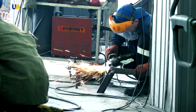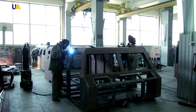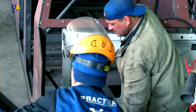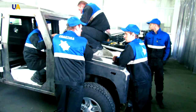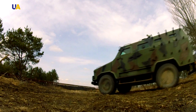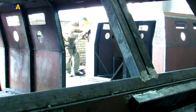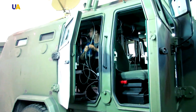During welding of the armored parts, a framework for each module is created and the armored parts are welded together into housing. Armor is weaker in welding spots, so those places are covered with additional closing plates. The engine is covered with a special armored box. The fenders and hood of the vehicle are not armored, in order to reduce weight.